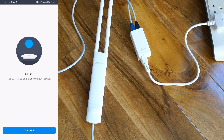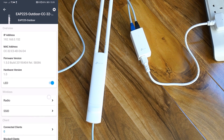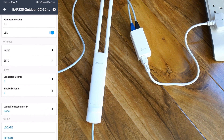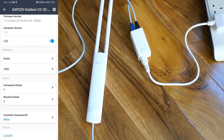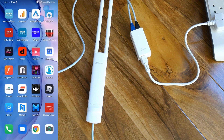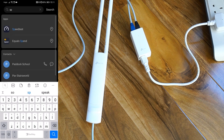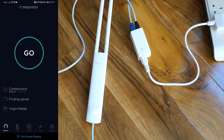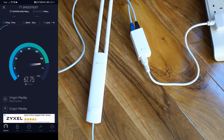Click continue and it's all configured. The app now shows all device details — you can locate it, reboot it, see how many clients are connected, and which are blocked. Let's connect via our mobile phone. In network settings you can see 'Back Garden' and 'Back Garden 5G'. Connecting to the 2.4GHz network first and running a speed test, the download speed is 98.6 Mbps and upload is 35 Mbps — which is fantastic, comparable with what I get inside the house.